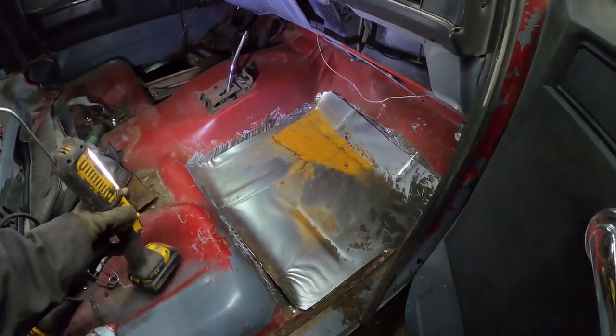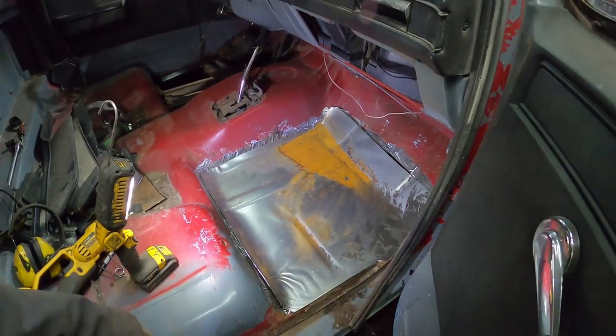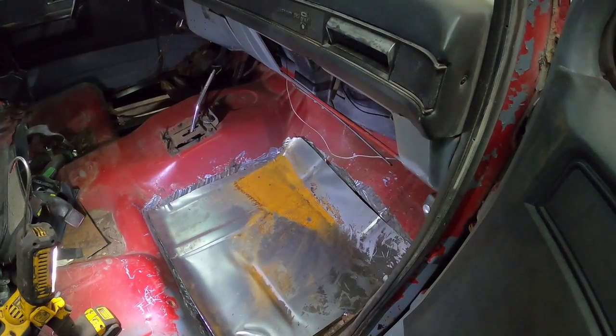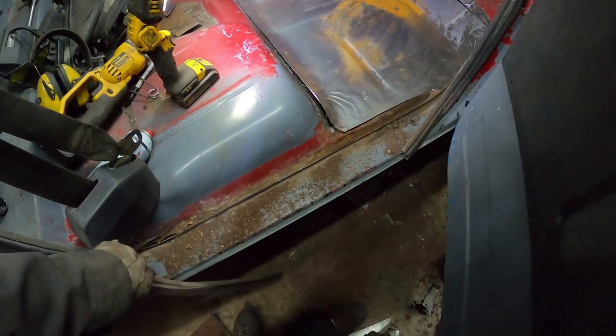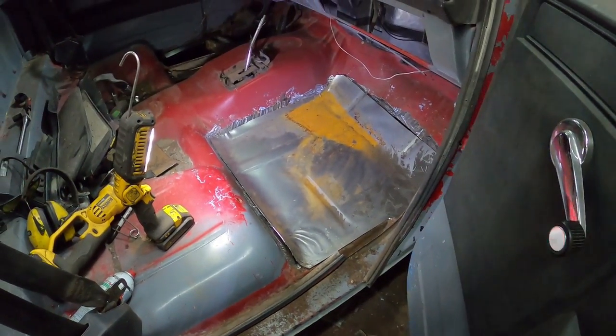And really, that's what it's going to look like - nothing too fancy. I'm putting some tech screws in to kind of hold it as I weld it around, and we're done with it. Clean this all up - it actually goes right up in here, which is nice because it was kind of rusty so I can get in there. This is all still solid, a little rusty, just full of junk. But this side was quite a bit better. Once the weatherstrip goes on, you'll never know the wiser.